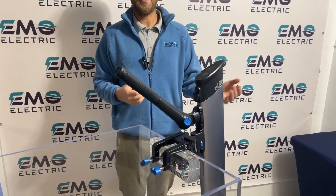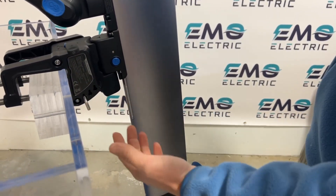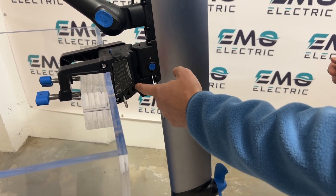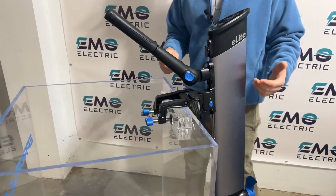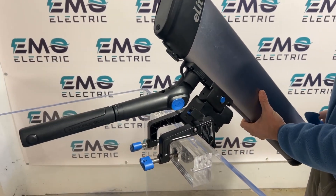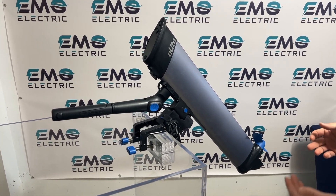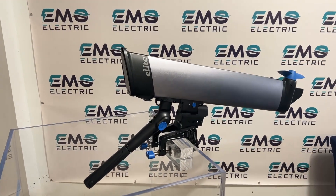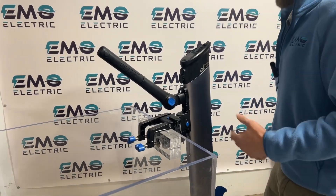The trim and tilt angle of the E-Lite is also adjustable. There are three positions for the pin that adjusts the angle of the motor when it's all the way down. Depending on the angle of your transom or motor bracket, you may need to adjust this — the goal is to have the E-Lite sitting straight down. To raise and lower the E-Lite, lift up this pin and the motor can come up. One of the best features, which many small electric outboards don't have, is the ability to leave it halfway up in shallow water. To raise all the way, continue lifting until the motor is out of the water. To put it back down, push that tab back up and let it down.